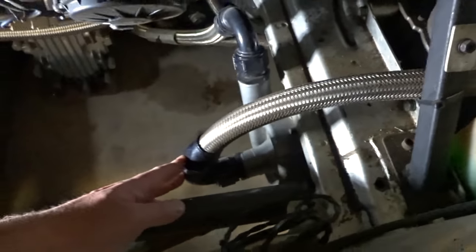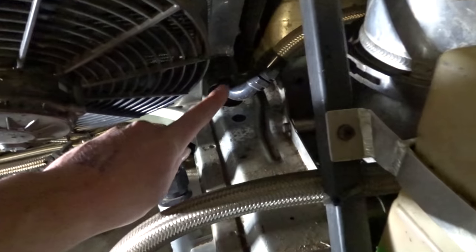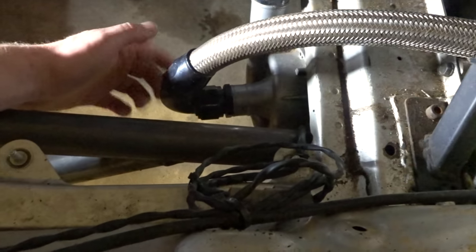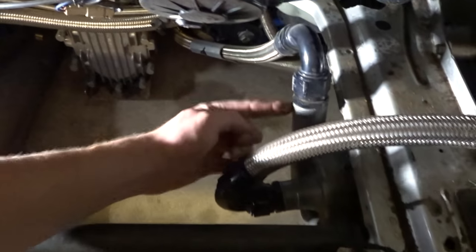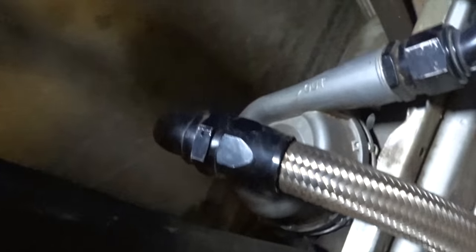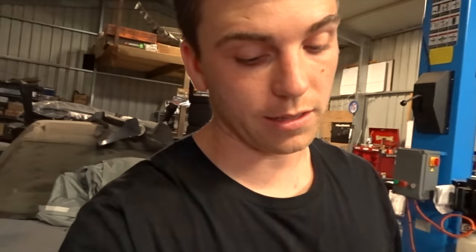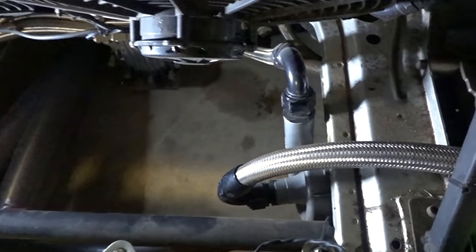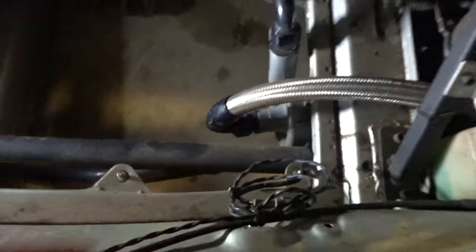And what you must do is actually have the hose, the bottom of the radiator, going in to the water pump. So if this was at the front of the car, you need to make sure the bottom of the radiator hose is going in, and then it's feeding the engine out of the side here. It looks like a little mini turbo. They come with the thread, so you can just screw in dash 16 fittings, which makes it really easy to put our Speedflow fittings on. This is just hooked up to the PDM.